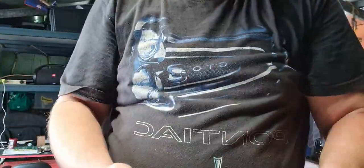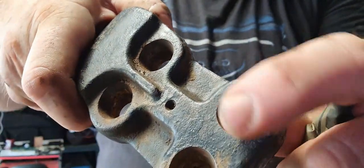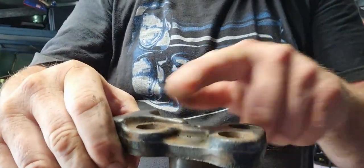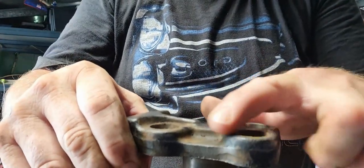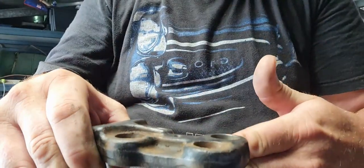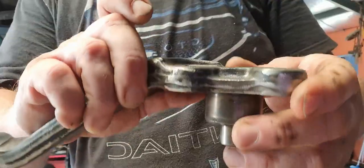Once I clean them out with the Dremel, the cones that go in there — when I'm setting them up for shimming I don't put the cones in. I just put a flat hard washer on top, stagger them, tension them down to 70 foot-pound top and bottom. Okay, happy happy.